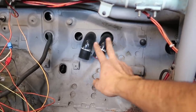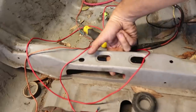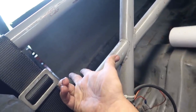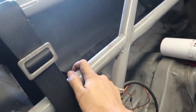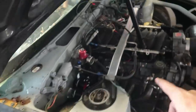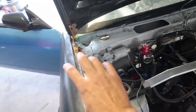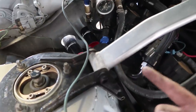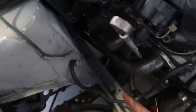We're going to run the line through this hole, which we widened a little bit. Then he said two straight couplers here — that's one piece — and then right here at 45 degrees it comes back to right underneath the bottom part of the firewall. That's where the other couplers are — there's a U right to the radiator, and the other one is at the top of the radiator. My fuel pressure regulator is going to have to move either here or over that way. The pipes are going to come over here, hug tight, one underneath the other, crossing across to a 90-degree fitting.